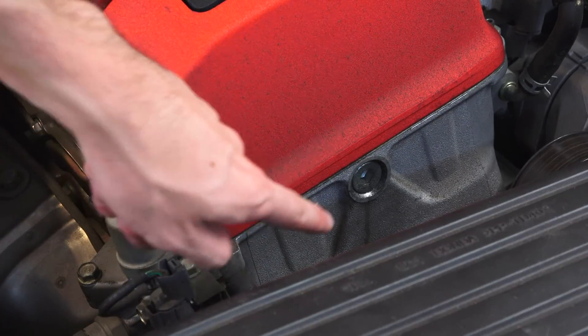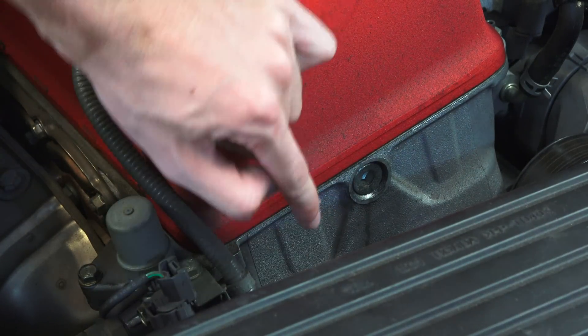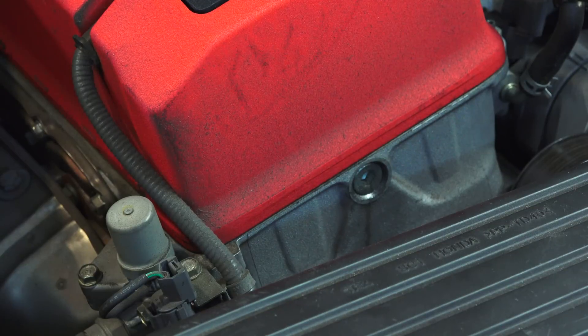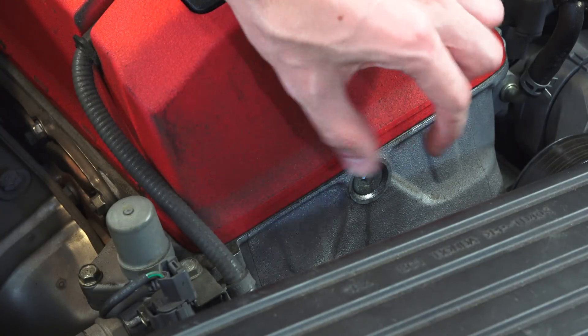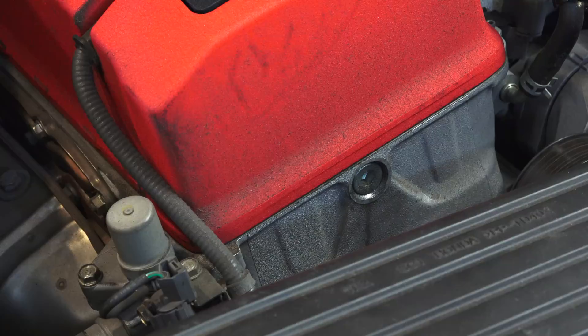Another thing — there's just a little bit of oil dripping out here at the front. This is a bolt that matches up with the timing chain. It's not a bad leak honestly. I was looking at some pictures and there are some that are a lot worse than this. So I went ahead and ordered an o-ring — it's like a dollar part. You can back this out just enough to get that o-ring on, pop it on, and then put it back in. You do want to make sure you don't fully remove it because you'll drop parts down into your engine. Someone correct me if I'm wrong, but that seems like the easiest way to do it.